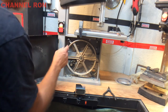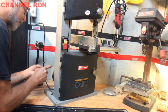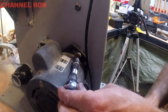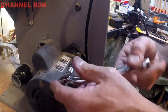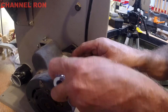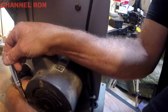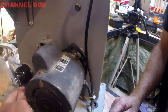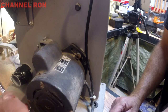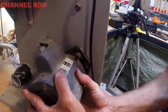I'm going to go ahead now and we're going to go on the back side of the motor and loosen it. On the back side, you're going to need a six millimeter hex socket. Go ahead and loosen up that motor, and then loosen that one as well. Now we should be able to move that motor up and down a little bit.